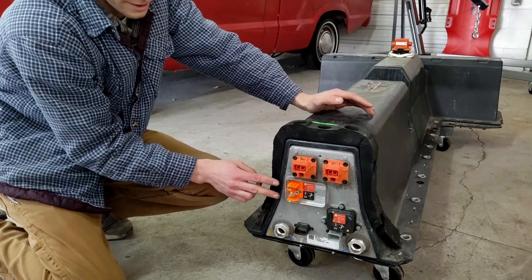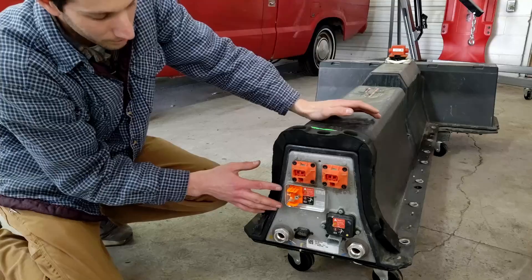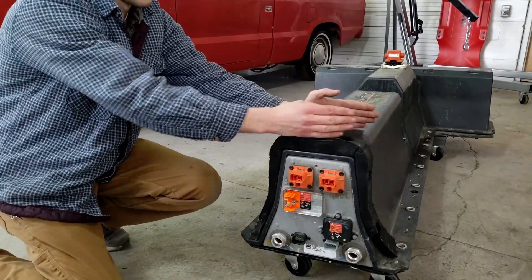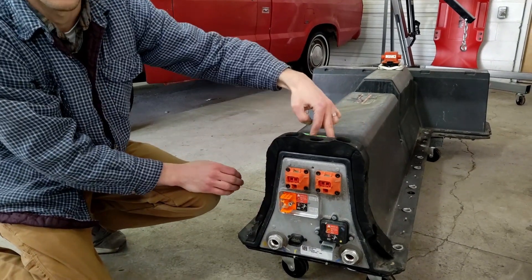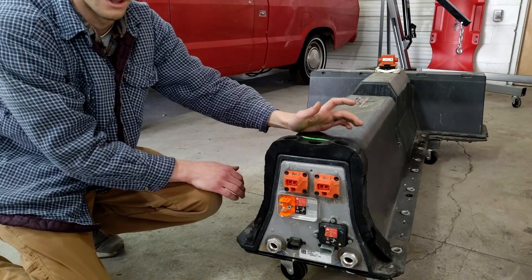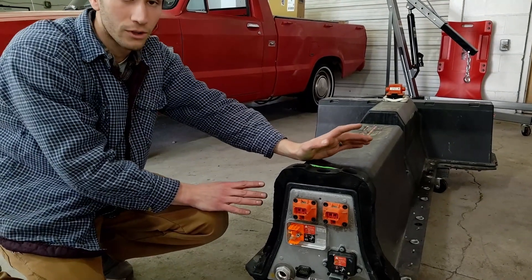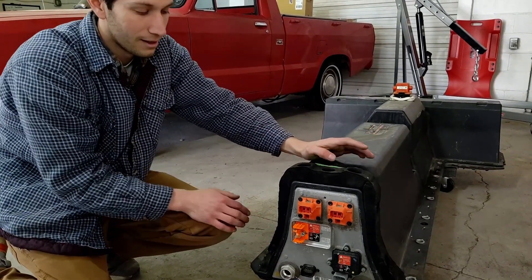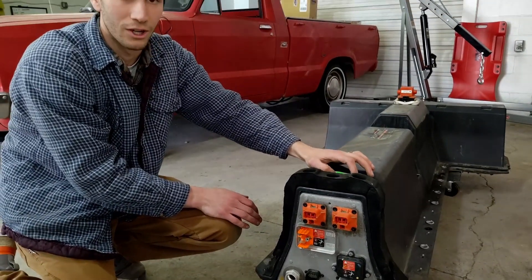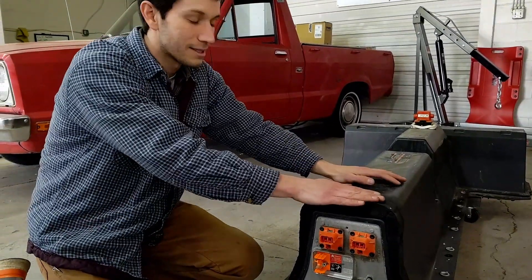These could be extremely dangerous at 400 volts, but I don't have to really worry when moving it around and shipping because they have main contactors inside. There's an electronics unit inside with two large contactors that can run 300 amps each — really expensive contactors and great for your own build, so we're going to salvage those. There are also three smaller automotive 12-volt contactors that will run 30 amps each inside, and we'll reuse those too. They're not cheap either, so there are a lot of great parts we'll reuse from inside this battery pack.